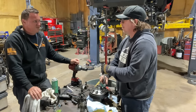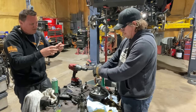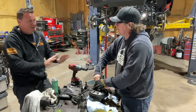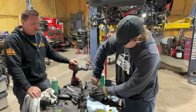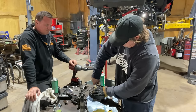All the heads had gotten really ground up inside a 513 gear that's probably so small, such a small pinion into the ring gear that the bolt never actually got into the gear, but sat there and turned and just ground it to nothing. There was no sign of bolt heads. Was the housing savable? Housing was no problem. The ring and pinion were trashed, and so much metal went through the bearings. Oh, I bet.